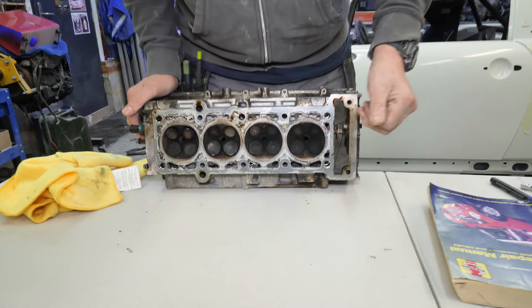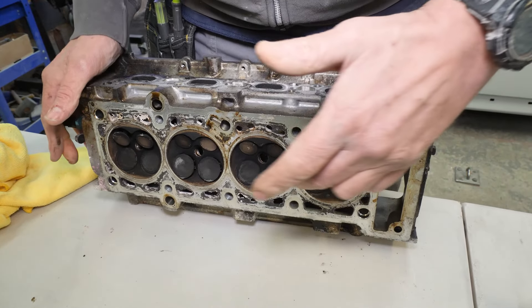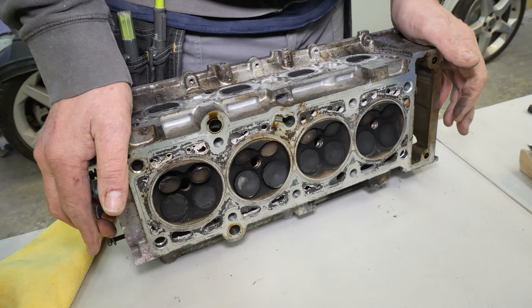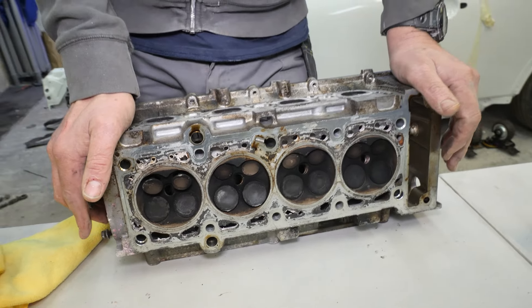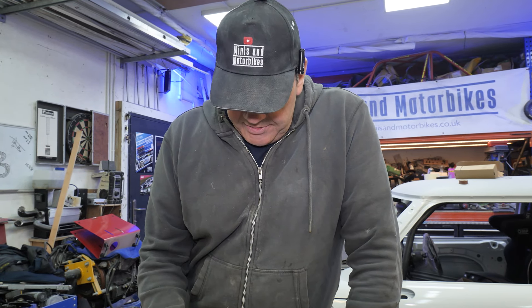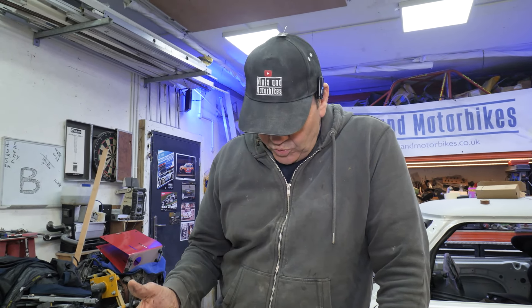So what are you going to basically end up with? Just the casing. And then basically he's going to re-seat the valves for us and everything. Now, I was told that the exhaust valves on an R53 Supercharged Mini are stronger than what they are on the R50. Mr Roper said he's sure they're all the same part number. And when I've tried to buy new ones, they all seem to have the same part number — it says for an R50, R53, R56. So I'm not sure if they are stronger or if it's just an urban myth.